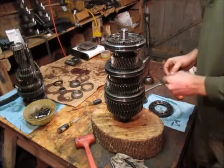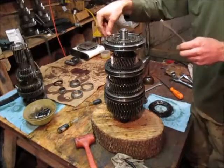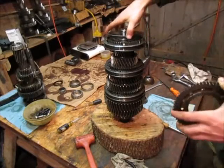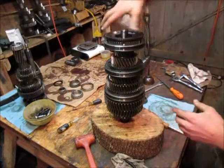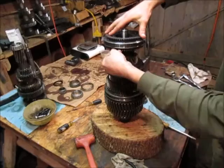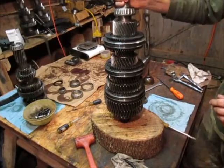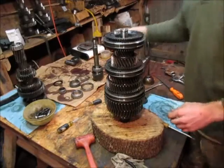Now we got the shift detents - just going to try to feed them in here. And then we got the fifth gear synchronizer - he's all oiled up and ready to go. You can see there are these notches here that sit in the same notches as before, like that. And then this guy goes on top like so. Then once you've got that in, you push down here and lift up like that. Now this guy's in neutral. So we've got sixth gear like so, and then the input shaft sits here, which is fifth gear. It goes on like that.